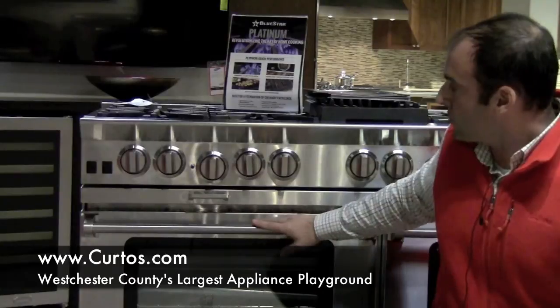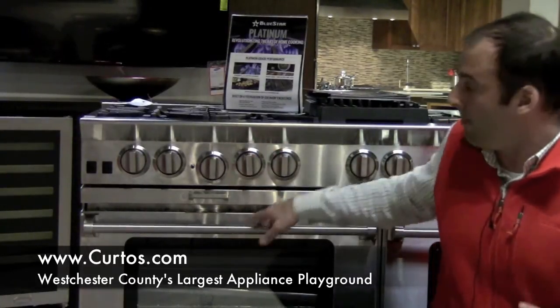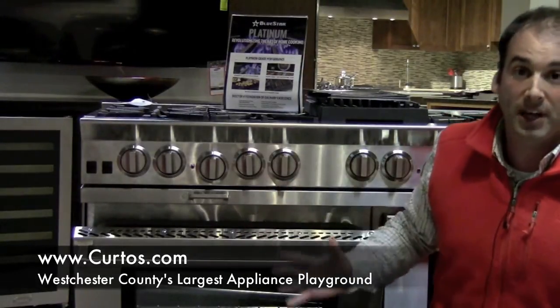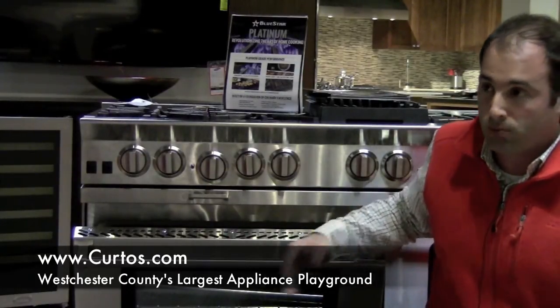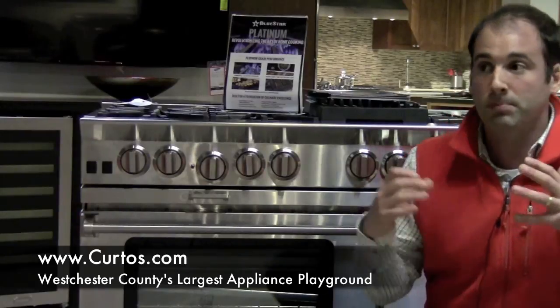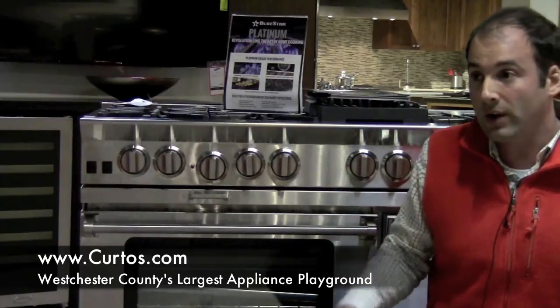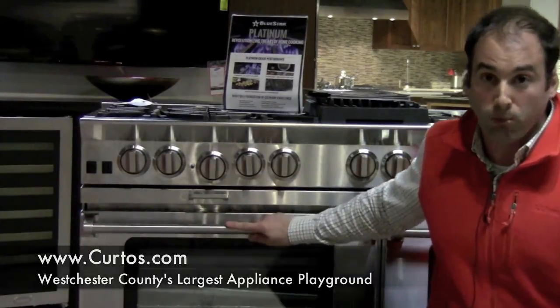This is one of the reasons why: this range doesn't use plastic knobs — they're stainless knobs. They're going to get hot and the manifold is going to get hot even with the door closed. If you had open door broiling, I'm not going to say these are going to melt off — it's obviously not going to happen — but they're going to get excruciatingly hot. I don't think it's safe to do open door broiling. Open door broiling is a thing of the past. I know some pro range companies, like Capital — I spoke to the people over at Capital and they felt the Culinarian you could do open door broiling with it, and there are some advantages to that. We'll get to that in another video. But the Platinum: absolutely closed door broiling.